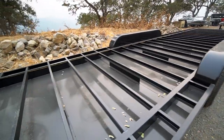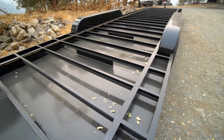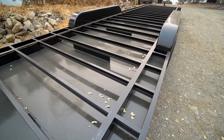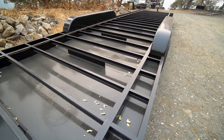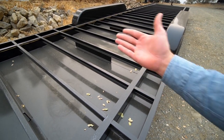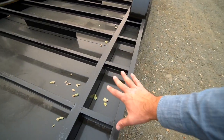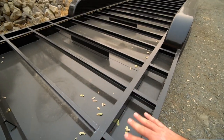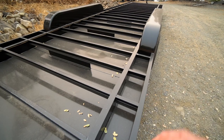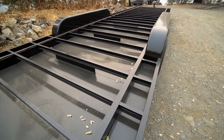And you can see right here, this trailer also has added flashing. Now we have that available from several of our locations. And this is welded and painted to match the trailer. So the purpose of the flashing, it's basically a belly pan and it allows an area that you could put insulation inside. So you could layer insulation in the inner deck and also the outriggers. So they're both the same. And then you could lay your plywood subfloor across the deck. You can glue and screw it to the trailer frame and then start framing your walls up from there.